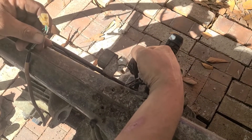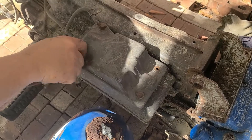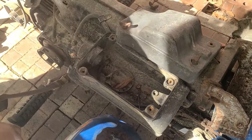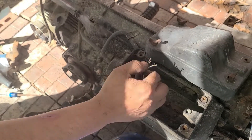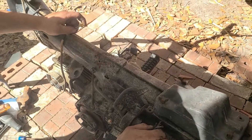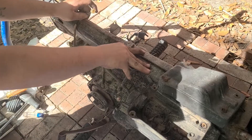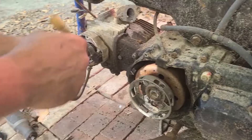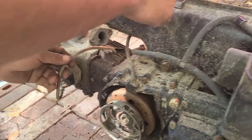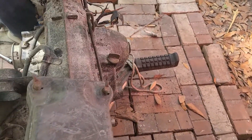We still have to wire in a round CDI plug — I think it came with a square one. This bike came with this particular plug sitting down inside the air intake of the air box. So we'll get this wired up. It's going to look ugly with wire nuts and stuff, but if we can get it to run, that's a good bite. Alright, the pulse generator is in, the mechanical CDI is in. We're going to start trying to get the wiring figured out. I still may be off a tooth on the timing chain, but we'll find out when we get that far.